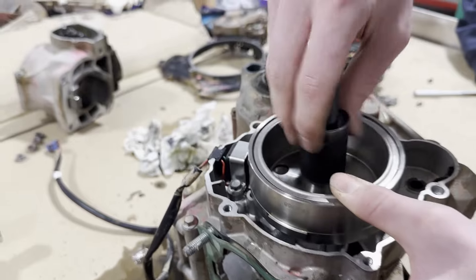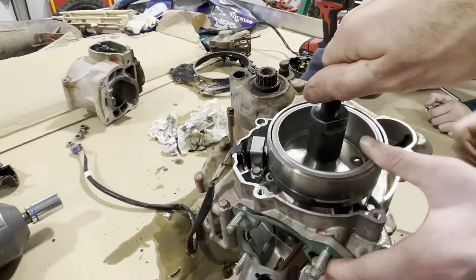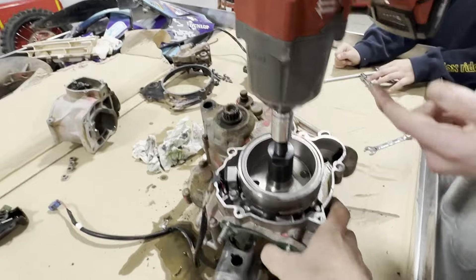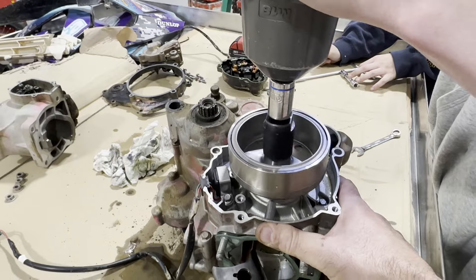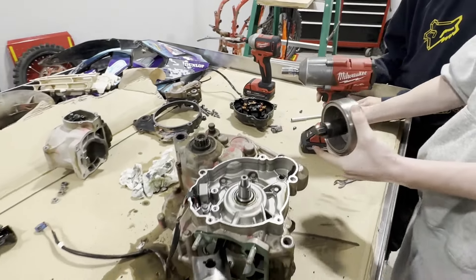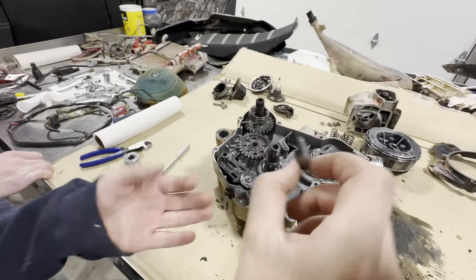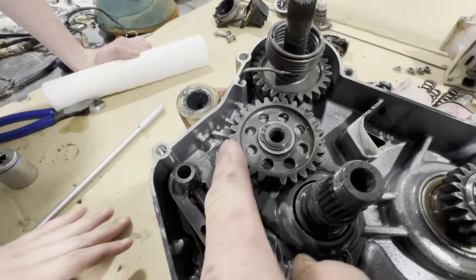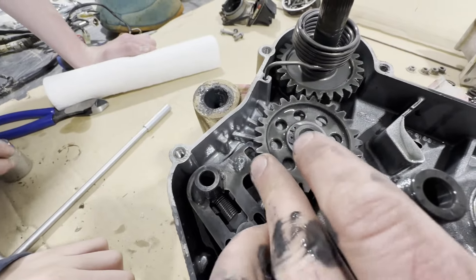There you go — feels better. Go until it kind of bottoms out, then I'll screw this down by hand. It's already down far enough. Good job. All right, what little piece did you guys just find inside there? I think that's more of like a transmission gear. But if you look here, this is the kickstart idler gear — we're missing a chunk out of that. That would still work, it would just feel notchy. And then this is the main bearing — I went to go zing it off and it's already loose, I didn't even touch it yet. This is spinning more free now.